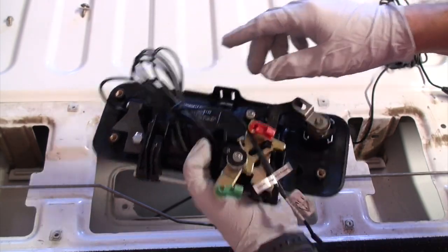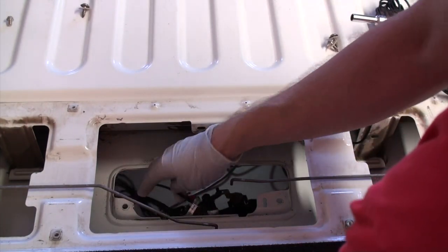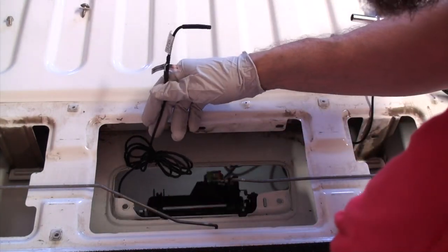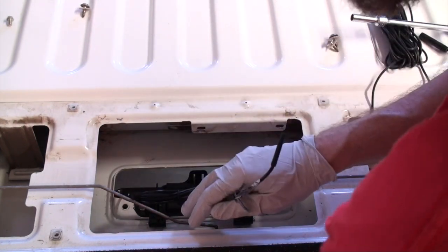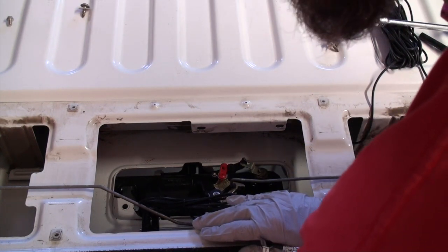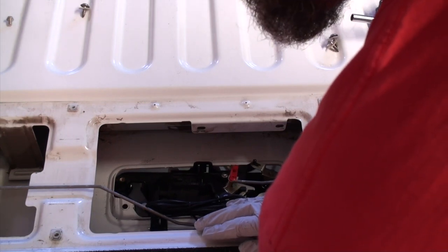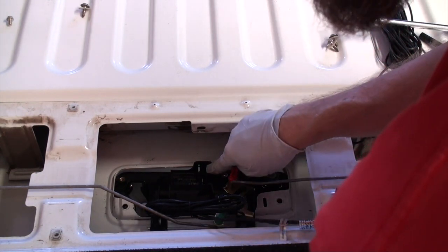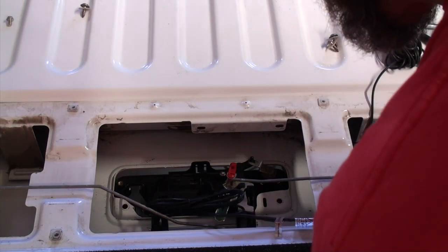The easiest way I found to do it after a couple of trial and errors is you bring it up through the bottom, and you rock it in. You want to rock it towards you. Again, that plastic clip will get it and hold it in place. Just make sure that you try and position it when you're first clicking it in so that you can see that your holes line up for where those 5/16 bolts are going to go in to hold it.